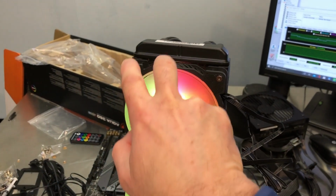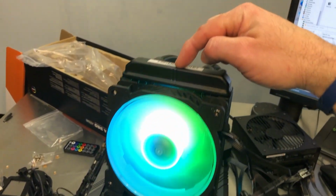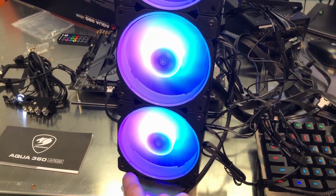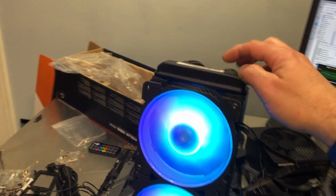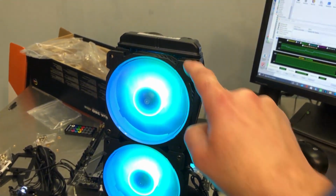And the coolant is traveling down roughly 1/2 of the radiator. It's actually not quite a 50-50 split, but it travels down one side and then changes direction at the bottom tank, which is all open, and then the coolant makes another path back up to where it leaves. So you're really going 360 millimeters down and 360 millimeters back.